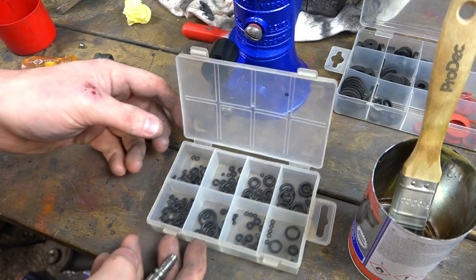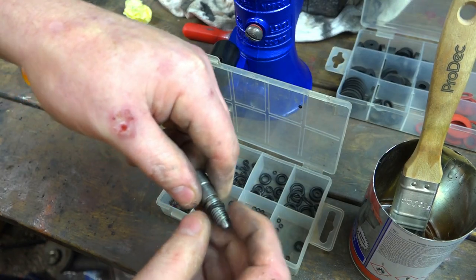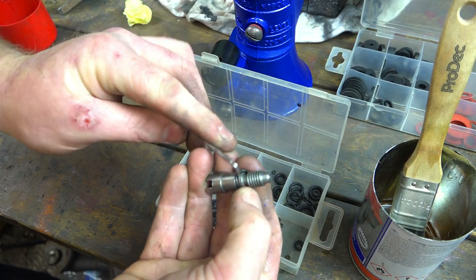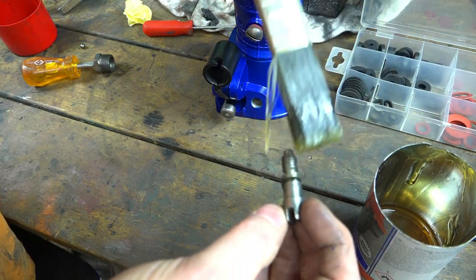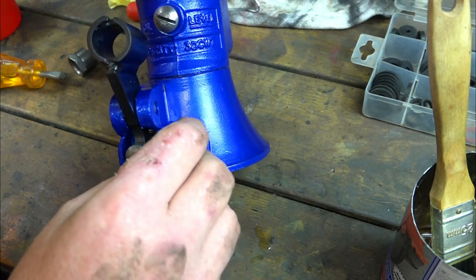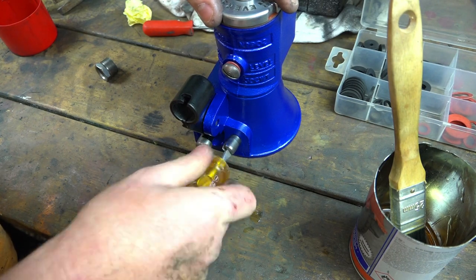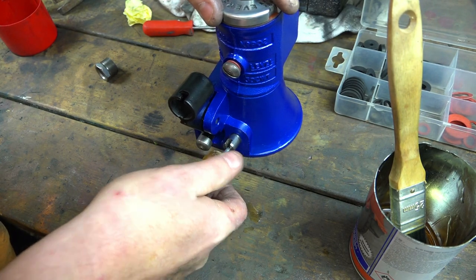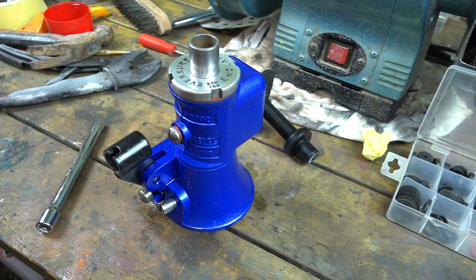These are all boxes of O-rings. I like to keep these - it's just basically a case of looking for one that's about the right size. Great little tools these, little hooks. Perfect. Same as last time, a bit of oil. Put the ball bearing back in. And this is what you'll undo to let the jack down - so when you want to let the jack down, you just undo that screw and the ball bearing pushes backwards.